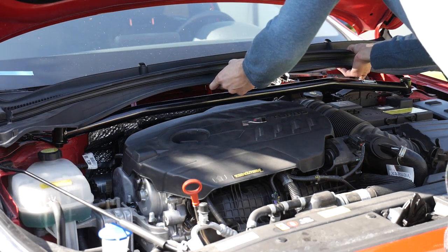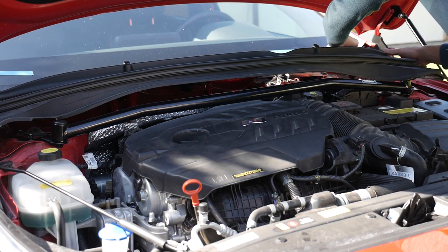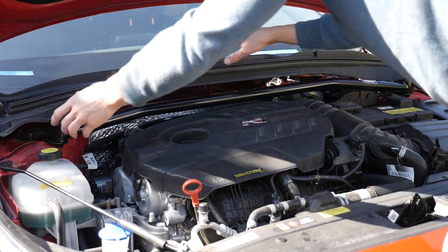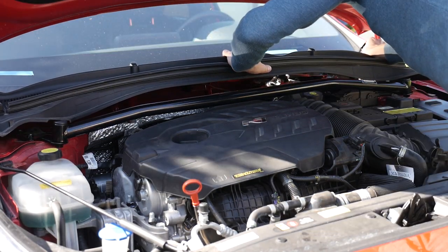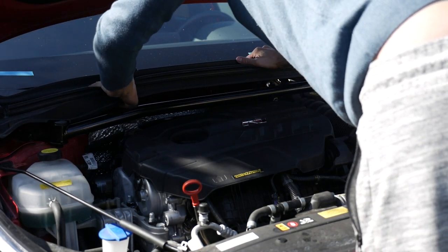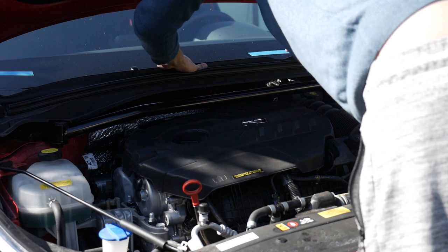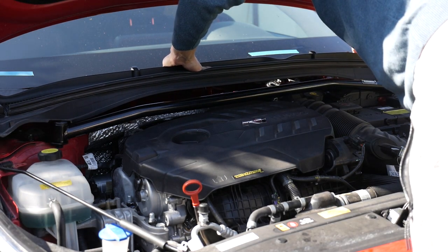Coming back to the repositioning of the cowl top, this part requires tremendous patience. Where exactly do the perimeter parts fit? As we work with very little space, it should be borne in mind that from one side we have a windshield, and on the other side, there is a strut that will tightly rest against the plastic edge of our cowl top. You see how I'm fixing the connection with the windshield where I try to get under the glass